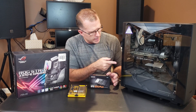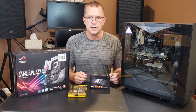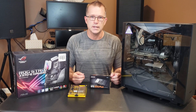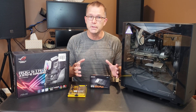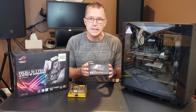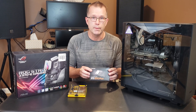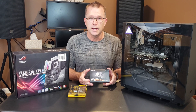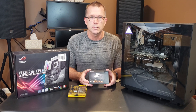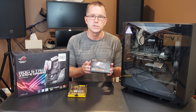I ended up going with a standard SSD drive. The one I have in here now is a Samsung 860 Evo — also a one terabyte SSD — but it's connected to my SATA channel. It's a SATA SSD, and unfortunately limited by the channel performance of SATA technology. Going to an M.2 NVMe SSD allows me to significantly improve my read-write performance over even a standard SATA SSD, which itself is a significant improvement over a standard magnetic spinning hard disk drive, which I also have in there.